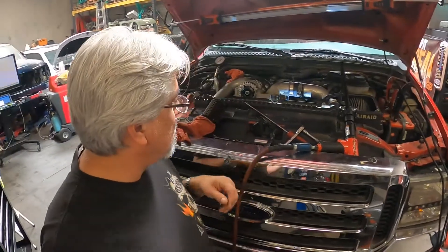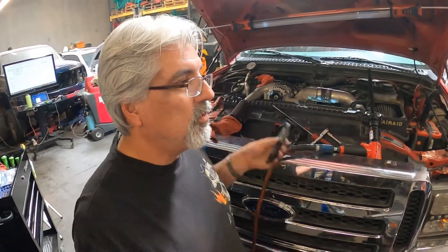You want to see oil pressure because you cannot have ICP pressure unless you get oil pressure. We had no oil pressure. So we went ahead and — let me show you right here — we took the front cover off the oil pump.